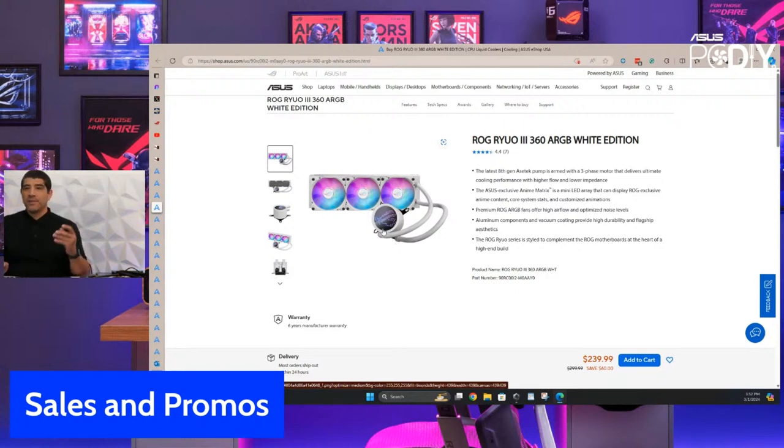Some people think just because I have a 7900X or a 14900K or 13900K, I have to buy a 360. 100% that's not the case. You can go back and watch our live streams where we've done real full on-the-fly performance tuning with overclocking, running game engines. And the reality is that your actual nominal power draw that you have to handle for a CPU when you're talking about desktop productivity and gaming is usually between about 80 to 200 watts.